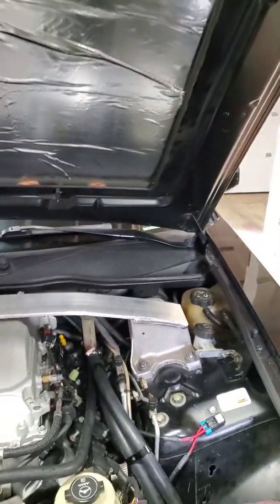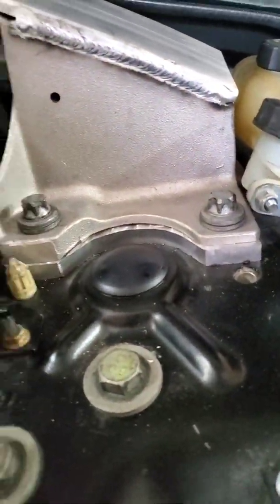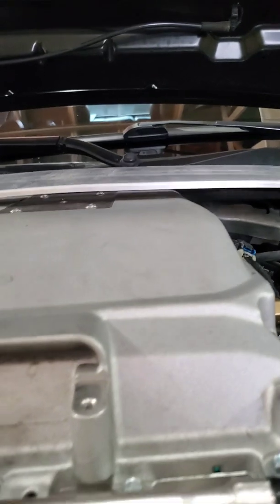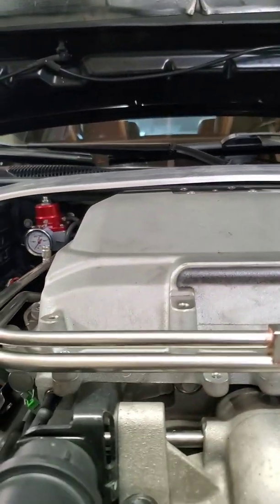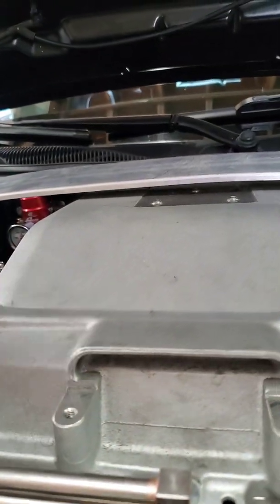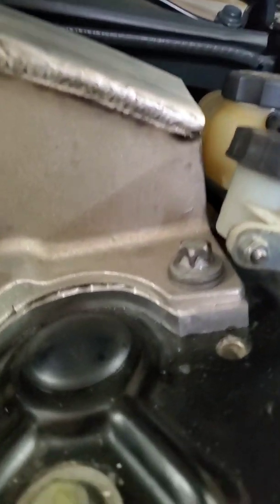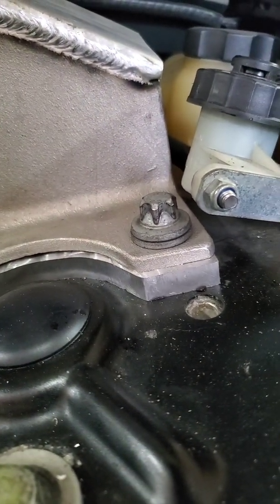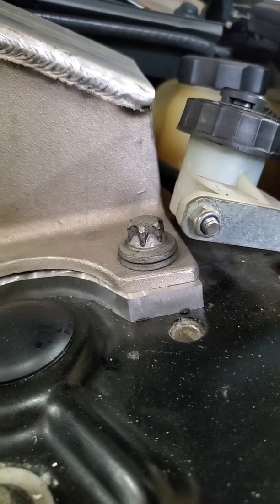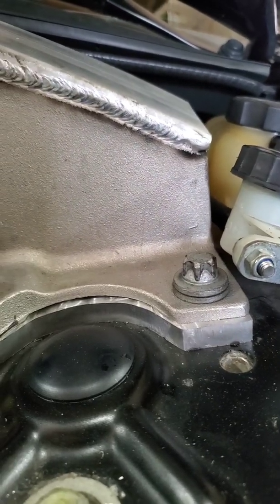A lot of people ask: does this fit under a stock hood? Yes — just cut the inside out. No holes, fits perfectly. I did have to make spacers to fit the V2 strut brace. It is very close. I have creative steel mounts and the lid does not hit the brace even under heavy acceleration. Those spacers are 10 millimeters thick of solid aluminum, and the bolts I just matched up something I had at work.